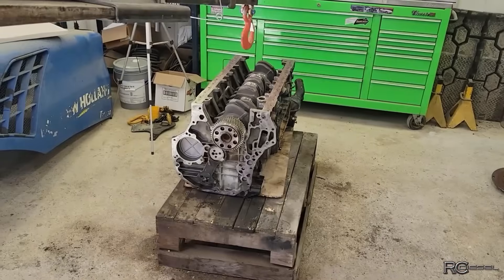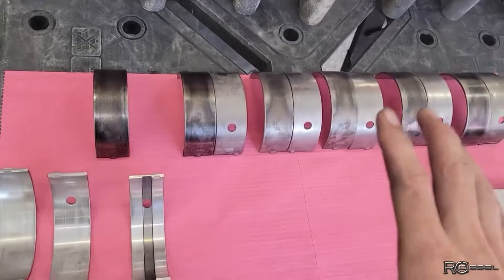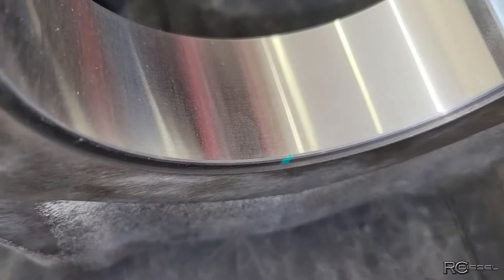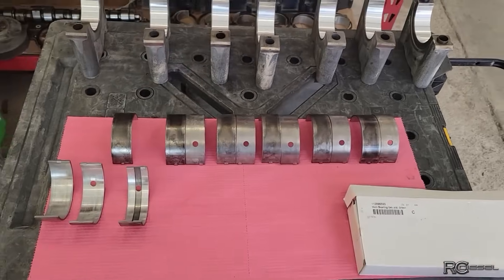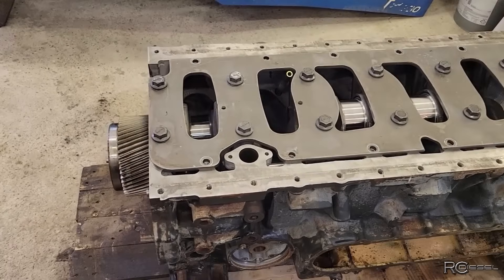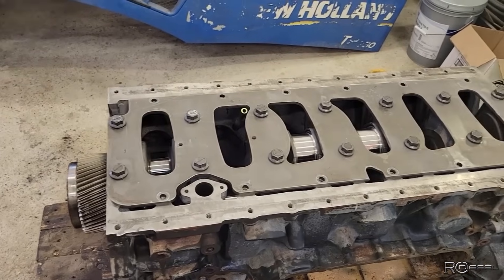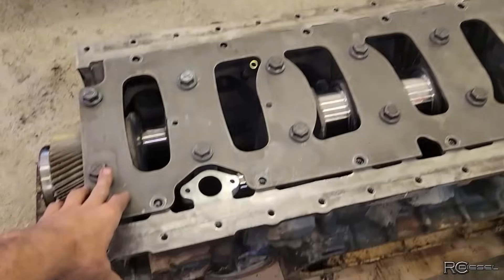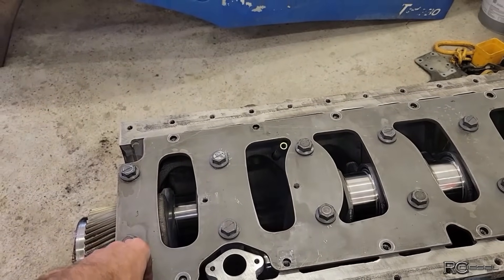The other half of those bearings are sitting there in the block. I've got the crank sitting there ready to plastic gauge. The bearings are measured, double checked. They were ordered as green color code, because these are green bearings — you can see the little green dot there. I got my plastic gauges in there, threw all the saddles on, threw the bed plate on — or stiffener plate, whatever you want to call it. I torqued them all up: 100 foot-pounds, then 60 degrees, then 60 degrees. And now I can take it all off again.